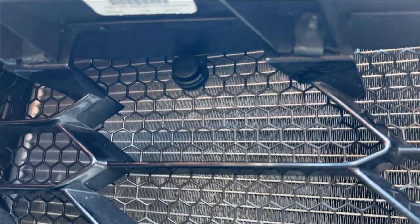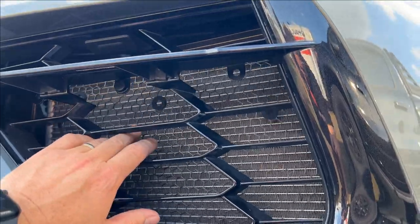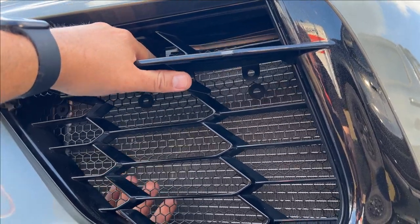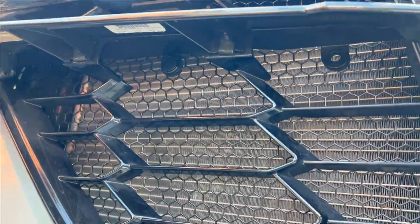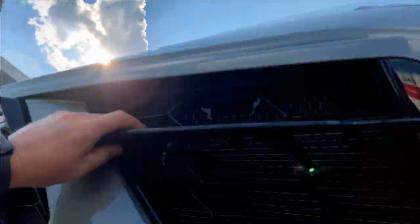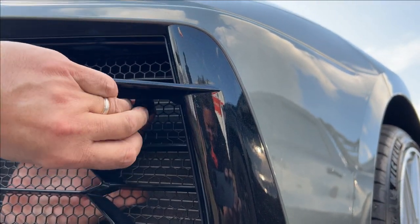He's sliding that up there and locking it into place with the push pins, which are also included. One thing we take extra care with is that the areas around the front button are all rolled and softened, so you don't cut yourself. When installing on such a beautiful car, Scott tries to align the notches in the fasteners so they all sit in the same direction — typically horizontally — and then you literally just click it into place. Just like a normal pop clip. A lot of use of the same kind of things you'd find on a GM car.